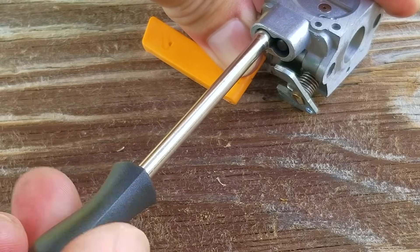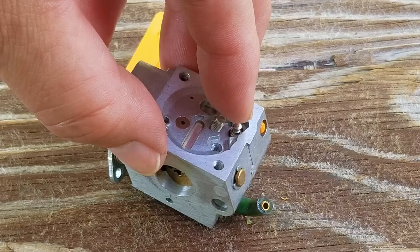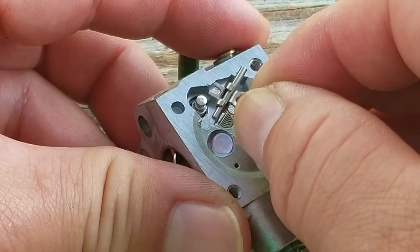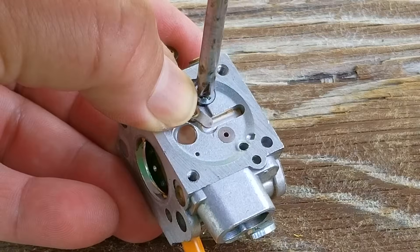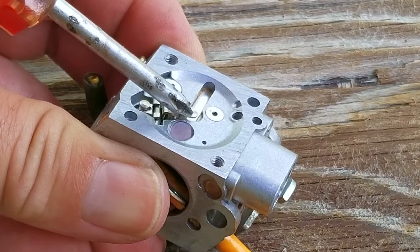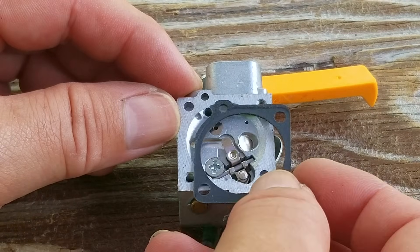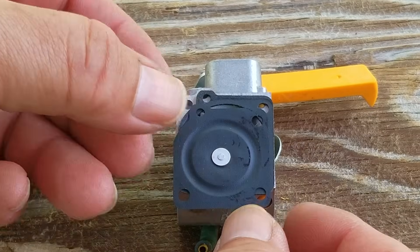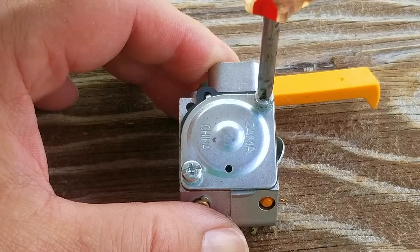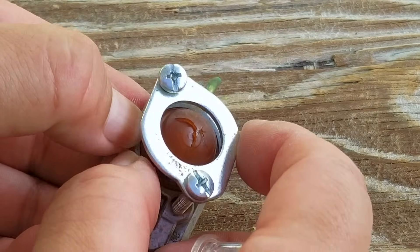Once the carb is fairly clean, it's time to put the carb back together. I'm going to start by putting the fuel adjustment screws back in. Once they stop turning, I'll then turn them out the same number of turns I counted before I took them out. Next, I'll put the needle and rocker arm back into the carb. If you don't think you can do this or don't want to go through the aggravation, then just replace the carb — a new aftermarket carb for this trimmer is only $12, so it's definitely worth it. After getting the rocker arm back into place, press on it and make sure it moves like it's supposed to. If it doesn't, you'll need to take it back out and try reinstalling it. Take your time because this part can be very difficult. Next, replace the gasket followed by a new metering diaphragm. If you need either a new carb or just the diaphragm, there will be more information about them in the description.